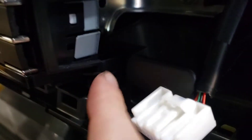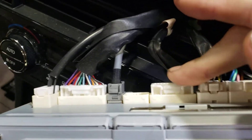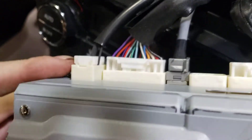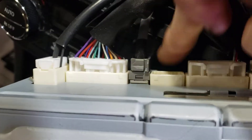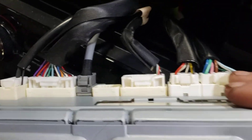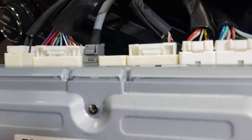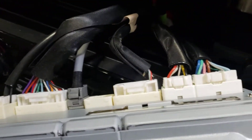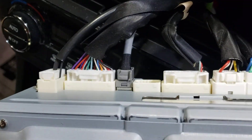The radio will be held in by little clips. Then you'll have a bunch of connectors in the back — a variety of connectors. They're kind of color coded, but just make note of where the connectors go. Some connectors may not be present if the car isn't equipped with that feature, so take a Sharpie and mark on the radio where the connectors are at so you're not trying to hunt a connector that doesn't exist.